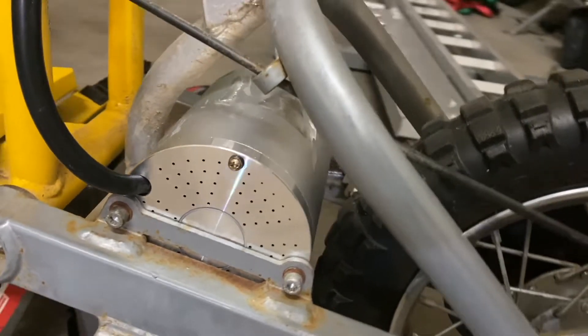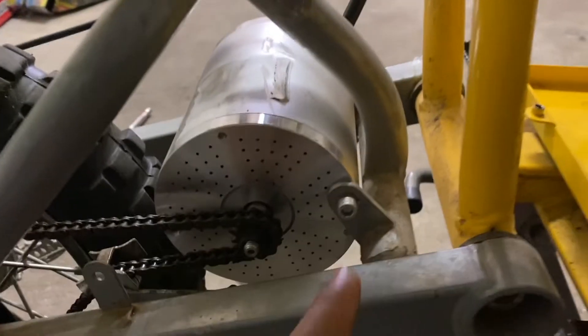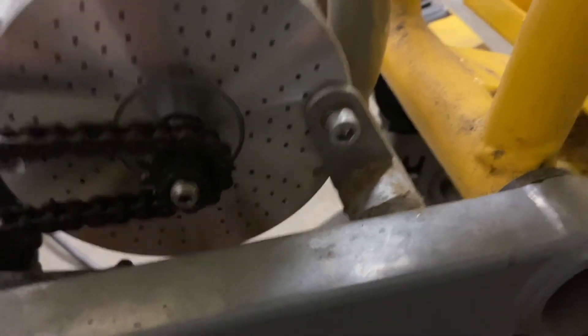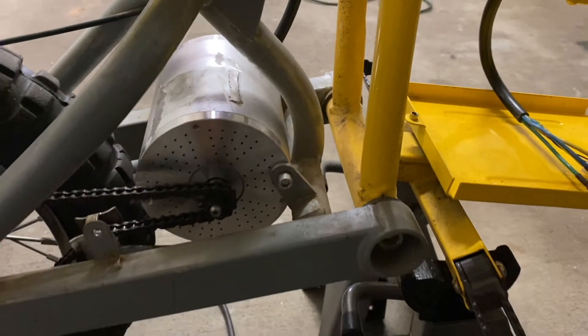Here's what the motor looks like mounted — the two case bolts that we countersunk are in here. The reason you have to countersink is so it sits flush with the inside of the swing arm. On the other side it's just one bolt, and the stud that we trimmed is the lower one which usually gets in the way with the bracket. That's it — installed easily.